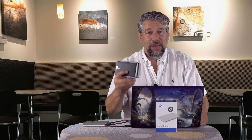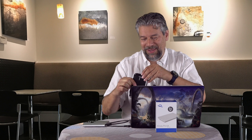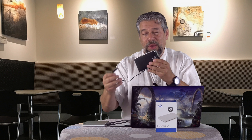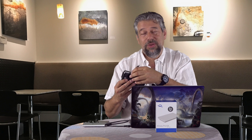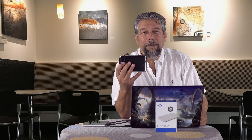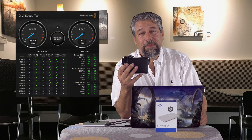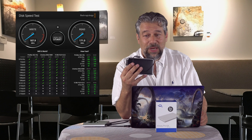Then I tried the Western Digital, which is supposed to be faster, certainly bigger, and definitely way heavier. It's actually a Thunderbolt drive with a built-in Thunderbolt cable, but it has the wrong end connector for my machine, so I needed to use an adapter, which does create a performance hit. Even so, it does pretty well — 187.9 megabytes per second on write and 171.0 on read.